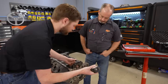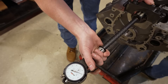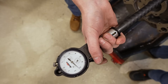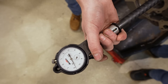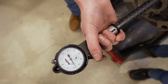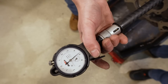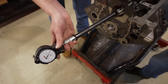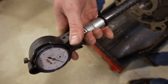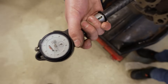Any measurement we get inside the bearings is our actual vertical oil clearance. We'll take our dial bore gauge, gently slide it inside the bearings, and just like the journals, measure at a couple of different points looking for the tightest measurement. Right there, that's 21 ten-thousandths, and that is the tightest point. We always measure this vertically — if you take it at a different angle in the same spot, it reads three thousandths there instead. The tightest point is always in the vertical position, so that is how we measure it.